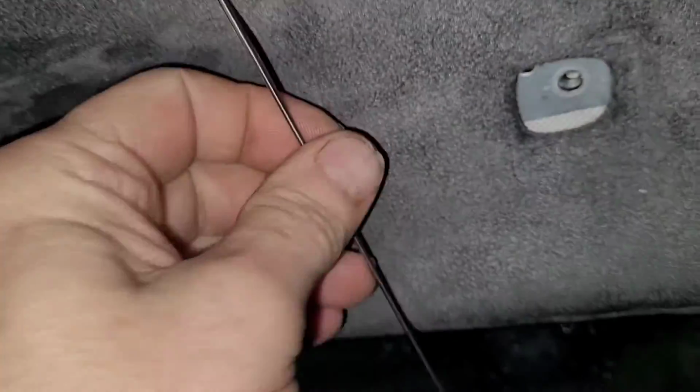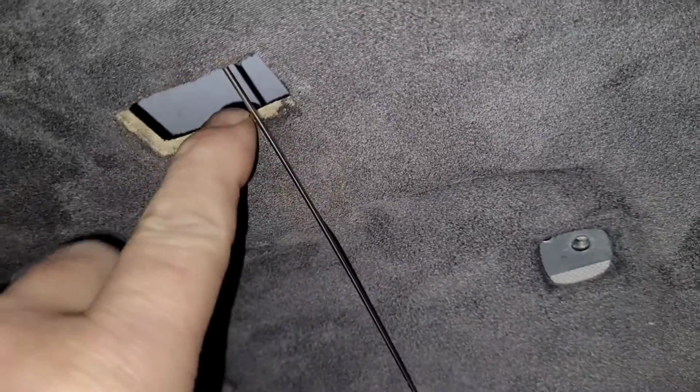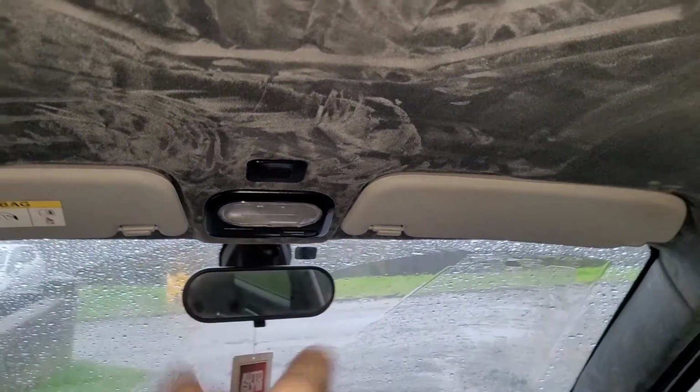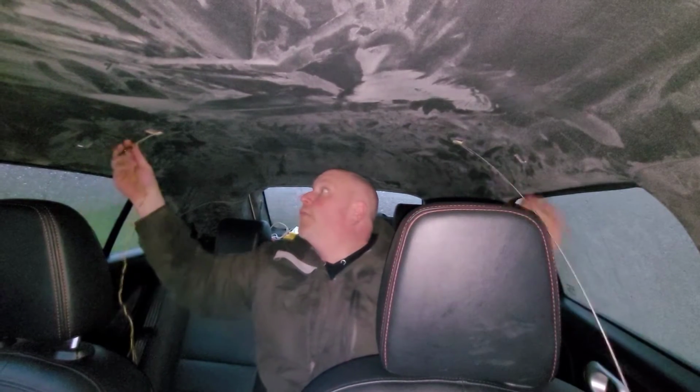Right, so I've done the hole on this side. Obviously you see me do the hole on this side, and I've got this CB aerial which I've threaded through the hole and out of this side, and I'm going to use that now to thread the wiring across from one lamp to the other. Once it's coming out of this side, I will do a T spur off in the wiring so that both the lights are wired in parallel, and then thread the CB aerial through and out through the front there so we can connect it into the front interior light. Right, so I've taped the wires to the CB aerial on this side, and then we'll just use this side and we'll pull the wiring back through.